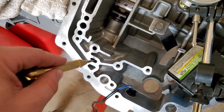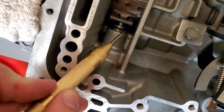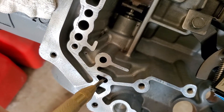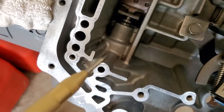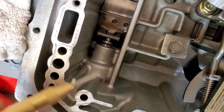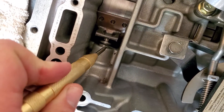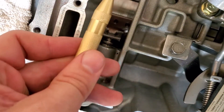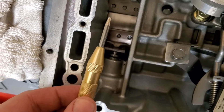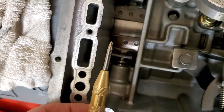You apply air to your band apply hole and this moves. I was trying to figure out why you need a drill bit in there, so I applied the air with and without it to see the difference. What happens is that little gap you see in there will totally close up if you don't have the drill bit in there. When you apply the air, the whole pin moves this way - that's the direction you're trying to measure the travel.